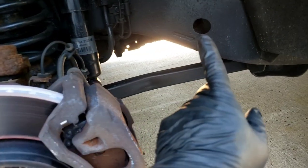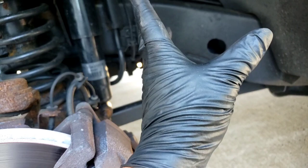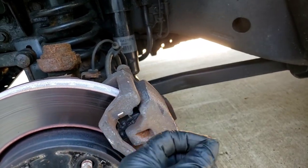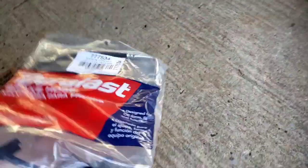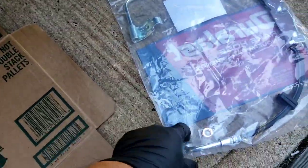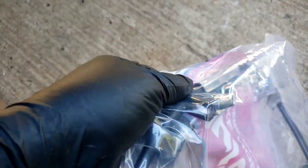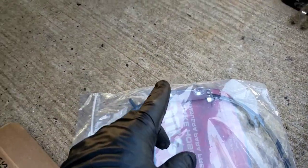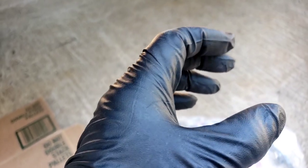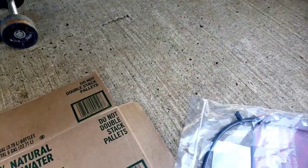Even though you're stepping on the brakes and forcing hydraulic pressure into the caliper, the problem is that the pressure doesn't release back into the master cylinder as easily. So it stays down, and because it stays on, it's like you're stepping on the brakes — that's why it doesn't roll. This is the replacement one, the Duralast. Here's that bracket — it grabs around the hose like that, and as the rust accumulates in that metal, it spreads out and gets fat, taking up the cavity in the seat and squeezing the hose until it's on the brakes all the time.